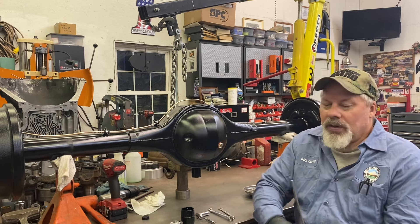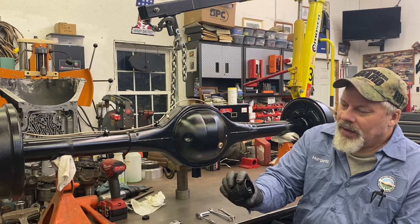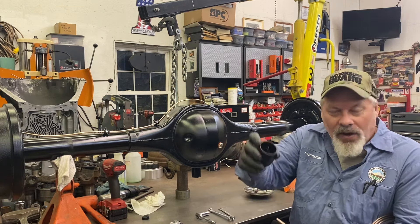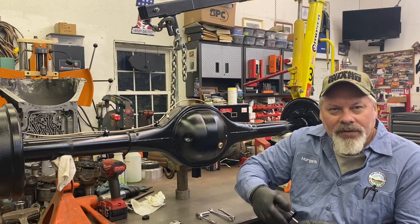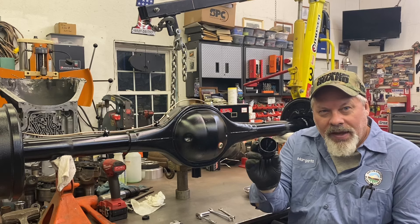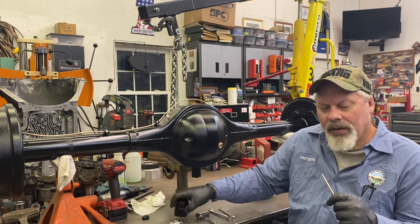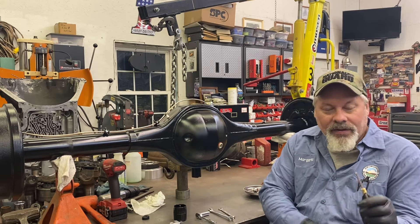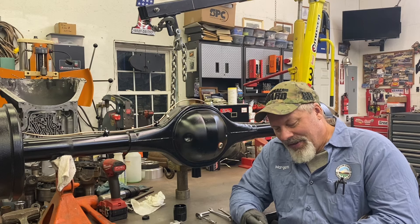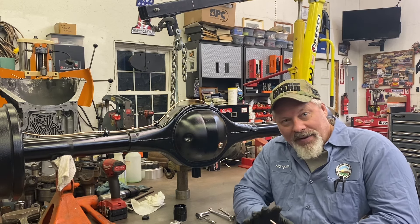So it's been cut off, but you have to address the fact that there's not a perfectly round hole. I don't know what you call this — a deburrer for pipe. You go to Home Depot or Lowe's, it's in the plumbing section. It's made for a plumber on probably bigger line, but this side has a cone and you can do the inside. The nickel copper is so easy to work with — it doesn't take much to clean out the inside. This end is external — it cuts down into a little teepee, so it does the outside, takes the burrs off. Now we have a perfect hole to work with. We'll put the nut over it. Try to remember to put it on there before you flare — it's just easier. Now I'm going to go over to the machine and flare this end.